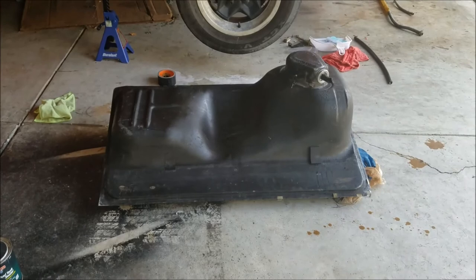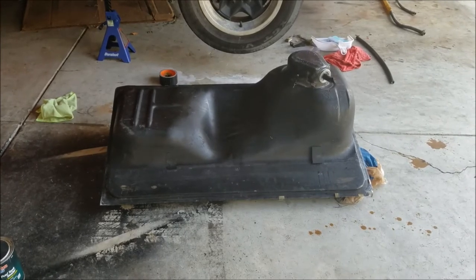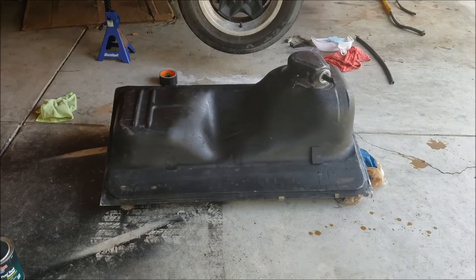But more importantly than that is right now, here's yet another critical point. I poured out as much as I can. I still see a little thickness in there, but that's to be expected. So I'm laying the fuel tank as flat as possible right now, just so any excess will dry over the widest spot of it. And I put a bag underneath where the drain off is, so it can catch any excess that may still run off. So right now I'm going to get this tank a bit more level so it's flat on all surfaces at the bottom, and then we wait 96 hours to check the results. So 4 days from now I will have a POR15 fuel tank, and we'll see how that looks. So I will see you then.